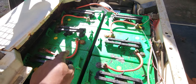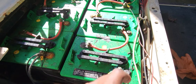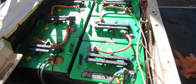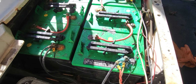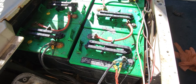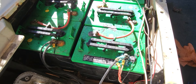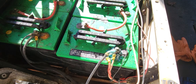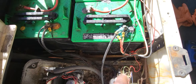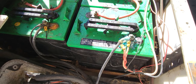We're going to replace all of these battery wire terminals — put new ones on — and clean the battery post on each one. We do not use Coca-Cola. What we do is wet the batteries with water, then use a wire brush on a drill and clean them individually. We put water on them just to keep the dust from that corrosion from going up into the air and us breathing it. That green stuff is toxic — you can actually feel it burning the back of your throat or nose. Wet it down, and when you use the wire wheel, you do not inhale that corrosive material.